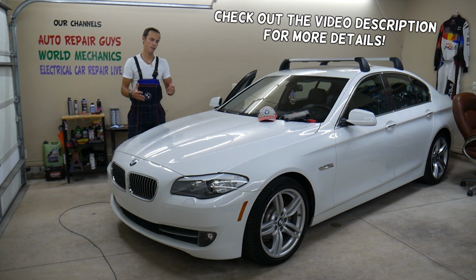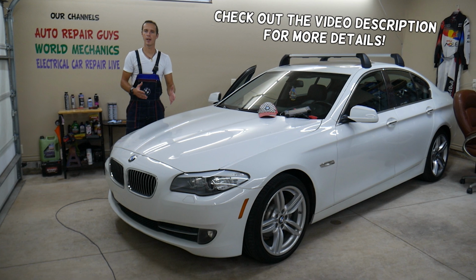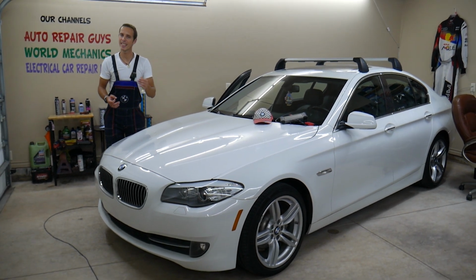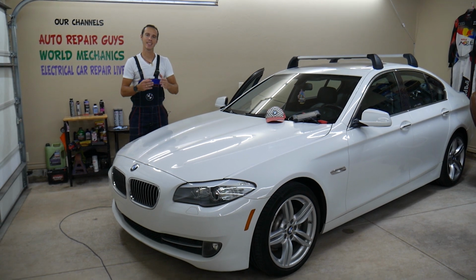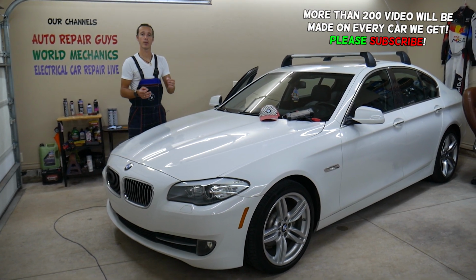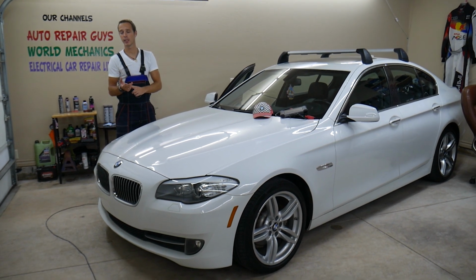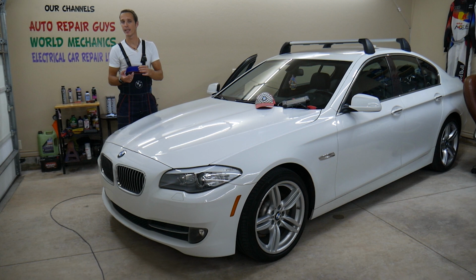Today will be a super helpful video to any of you having a BMW 5 Series, generation F10 F11, and it may even work on E60 E61. If you need to disconnect airbag wires, stay with us, we'll explain how to do that, because if you do it the wrong way, first you can damage the connector, which is very expensive. Sometimes you need to replace the whole wiring harness, or you may need to replace the connector itself.